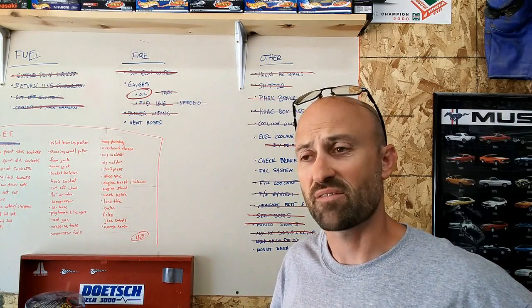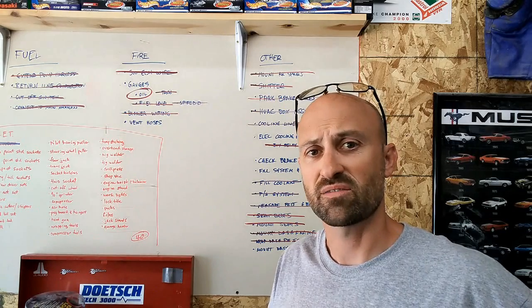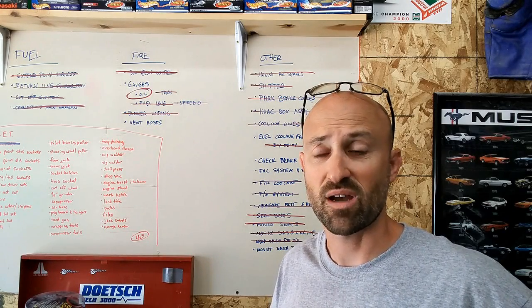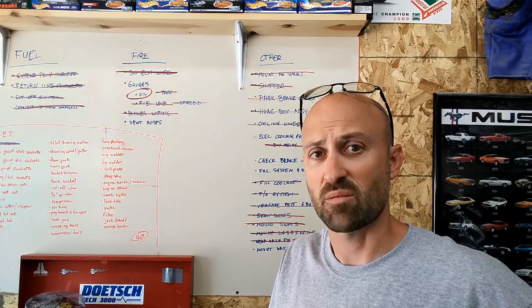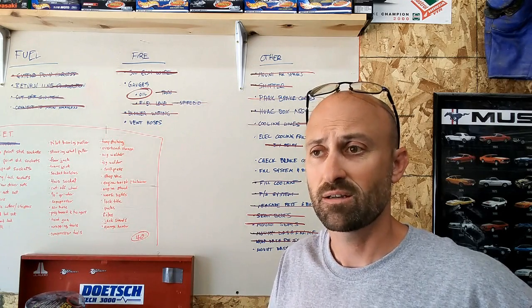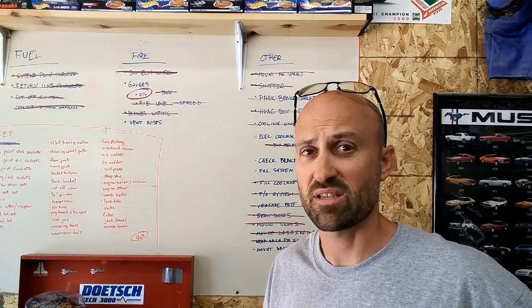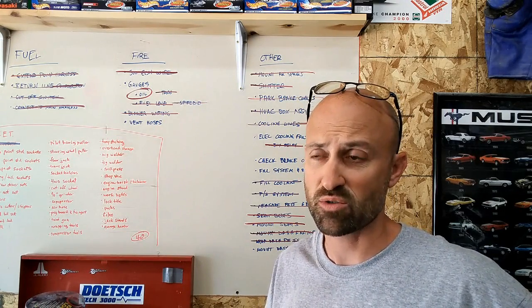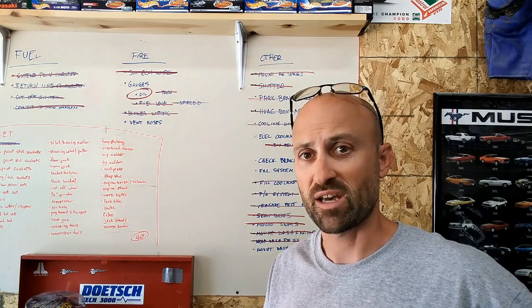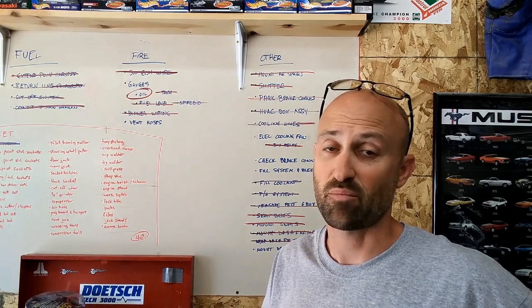All right, so what I have left is to bleed the brakes. I've obviously got the car lifted up. I have the wheels and tires out of the way. I need to put the pinion snubber, or the pinion bump stop, on there for the rear end. That just needs to mount in the body. The 80 did not have it, so I kept the piece off the 92. I just need to drill the holes, put in a couple rivnuts, bolt that in, that's done. Then fluid in the brakes, bleed those, so I actually have brakes, which is good.